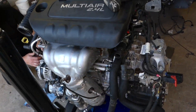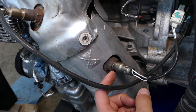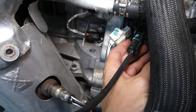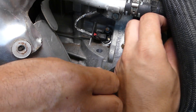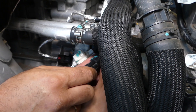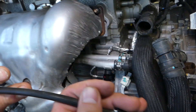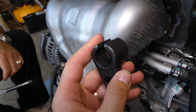First we need to disconnect the wiring harness. Follow the wire — you can see there are two sensors: this is the downstream sensor and this is the upstream. We have links for both in the description below. On the wiring harness connector, there is one tab on the back side that you press in, then pull it out to disconnect it.